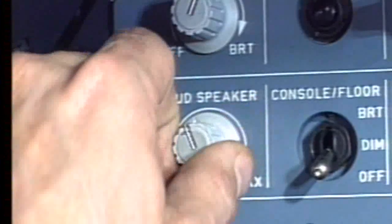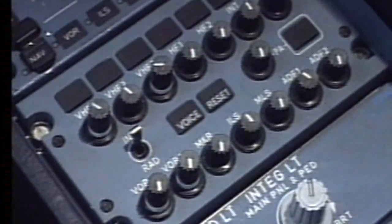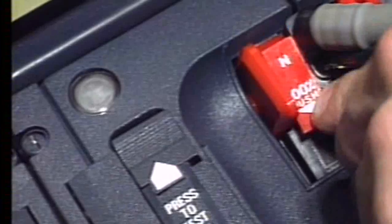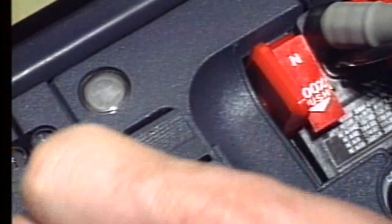The microphone is tested by activating the loudspeakers, the interphone, and by pressing the emergency rotation knob. When the previous tests are completed, make sure that the normal/100% selector is locked in the 100% position and the reset test slider returns to the up position.